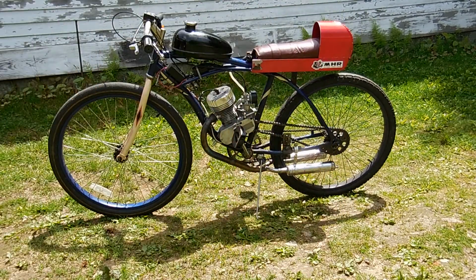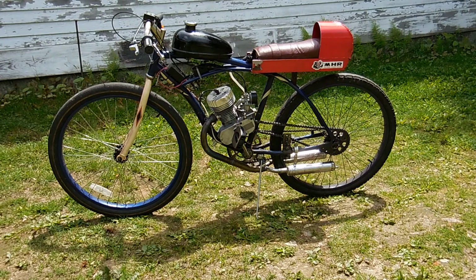Anyway, this engine, I'm going to call it the MPG engine. No expansion chamber, simple exhaust, and the stock exhaust will work. A banana type exhaust will also work, but this engine does not have the advanced exhaust port timing that my other engines, which are race engines, have. This engine produces good torque, and like I say, this is built on the Super Rat bottom end. It's a 40mm stroke engine.